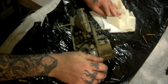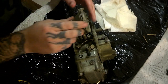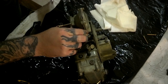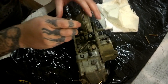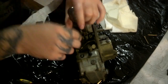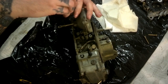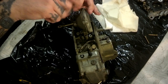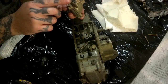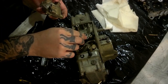Next will be what I call the vacuum — secondary vacuum, same thing. Three bolts. You want them tight but not supposed to be super tight, and not supposed to be loose either — pretty much finger tight with just a little bit of tension. No force at all — just a little bit of tension.